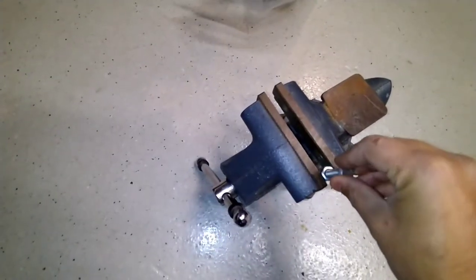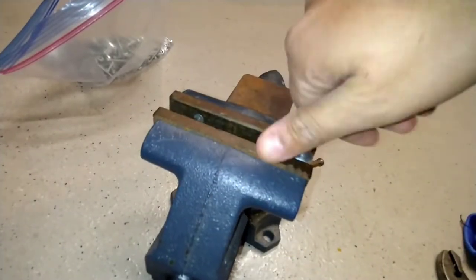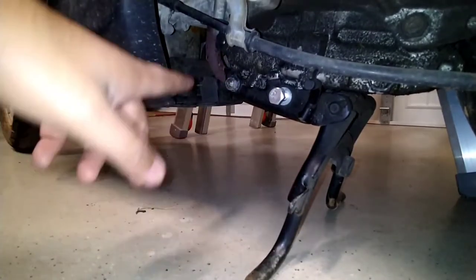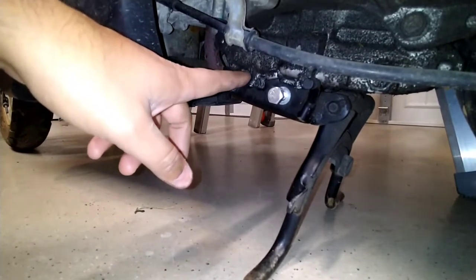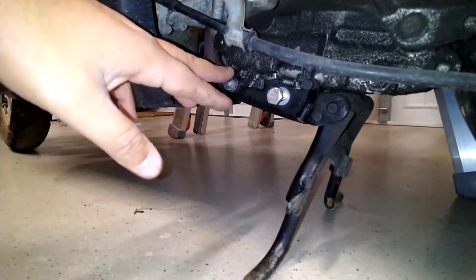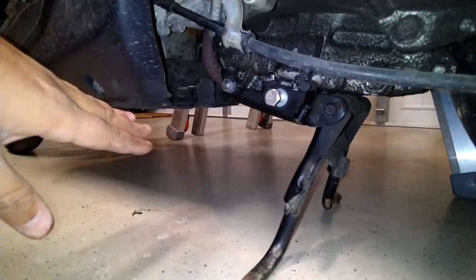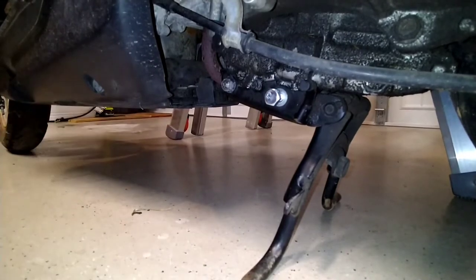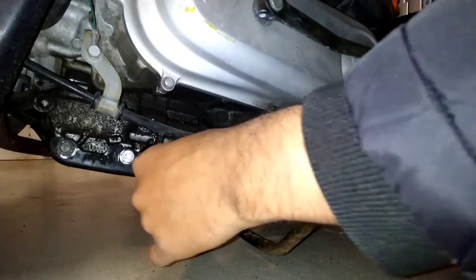Try to screw it into the steel bolt before I try to put it on the scooter. Thinking back at it, I think the reason that's stripped is because this was in the exact same situation last time, where I just kind of halfway threaded one bolt in that position and called it good. Over time, I guess that was taking all the force of the stand and that bolt stripped out, and I don't even think I bothered to put it all the way in. And it fell out. So this time, hoping on these three.